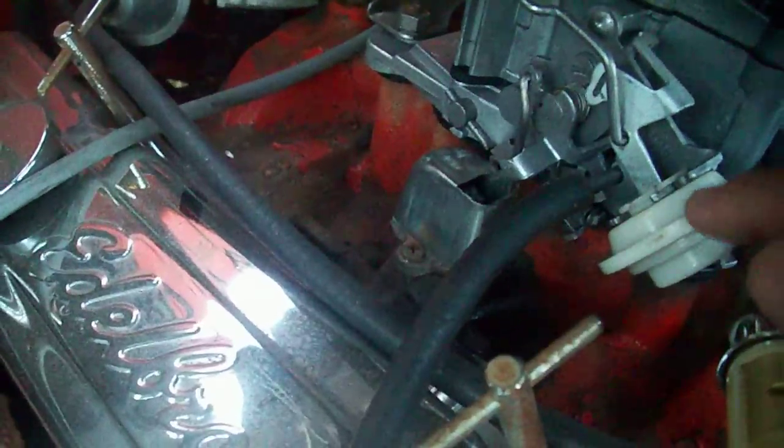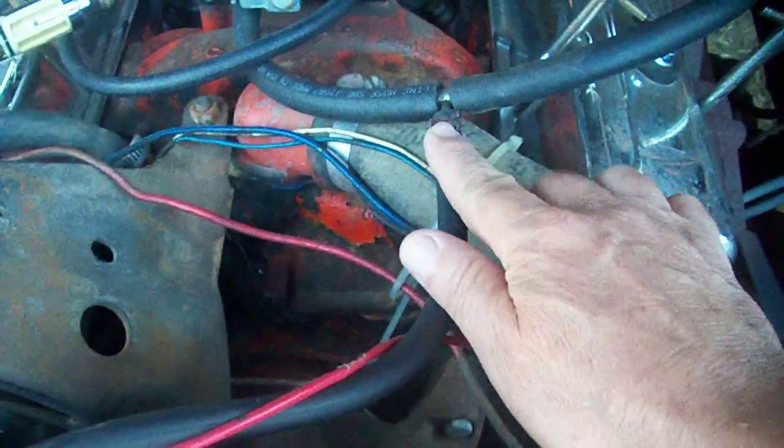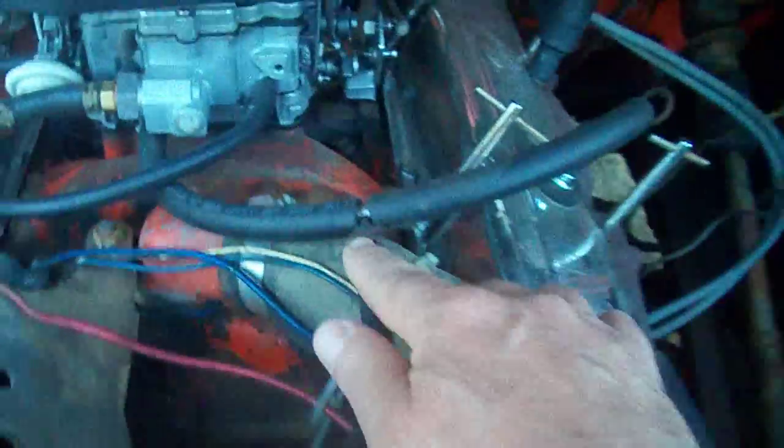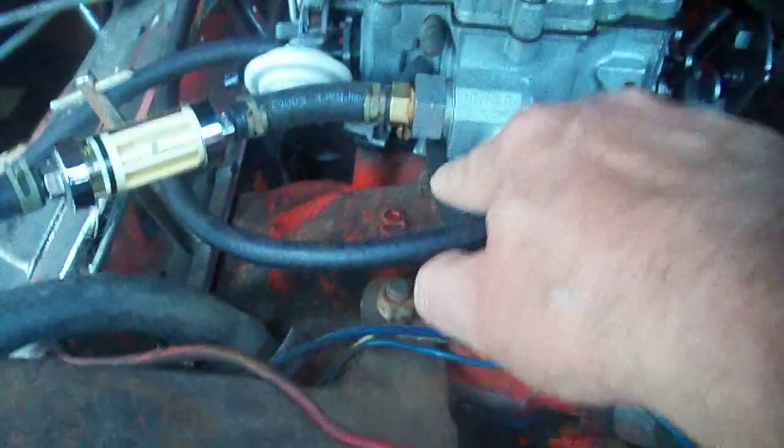The little one runs right over here, comes up, and hooks to the carburetor right behind the automatic choke. The second one I ran under my battery box; it comes out on the firewall, runs under the radiator cap, across the fan shroud, goes to a T, and hooks up to the manifold of the carburetor on the bottom — it has to be on the bottom for this line.